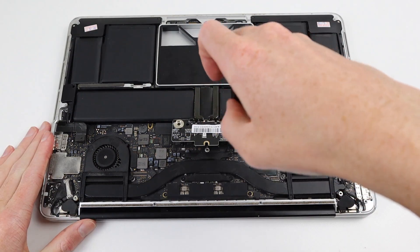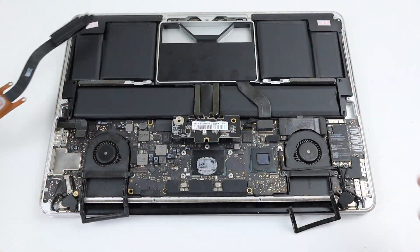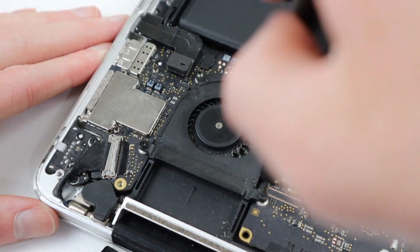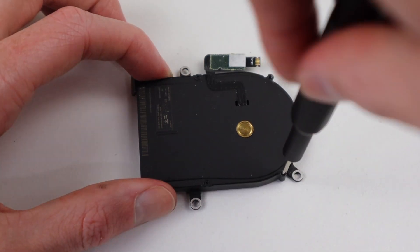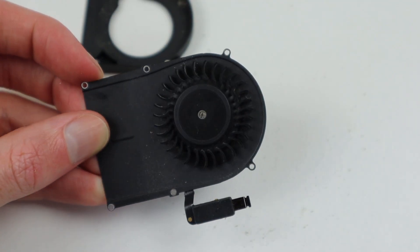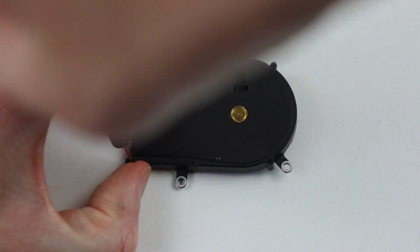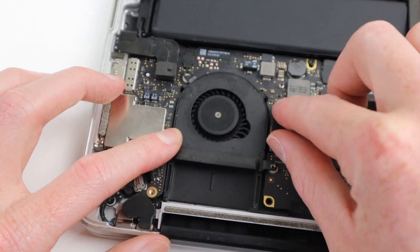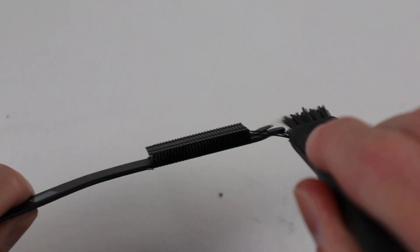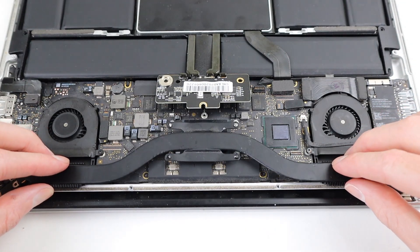With our major repairs completed, it's time to give the laptop a bit of maintenance by replacing the seven-year-old thermal paste and giving the fans a bit of a clean — in return, the laptop may run a bit cooler. After removing the heatsink, we can get a look at what I would call a lot of thermal paste. Cleaning that off with some isopropyl alcohol, I'll move across to the fans and get those cleaned up. I will open up each fan and give it a bit of a brush out to remove most of the dirt that's built up inside. After I'm happy with each fan, I can reassemble it and install it back into our MacBook Pro. I'll also clean up the heatsink using a cotton swab and some alcohol to clean the copper pad before brushing down the fins. After which, I can apply a nice drop of thermal paste and reinstall the heatsink back into the laptop.